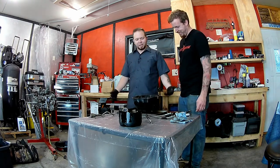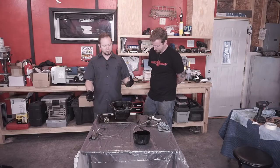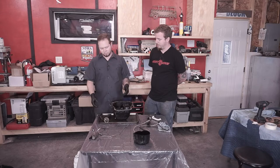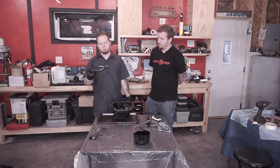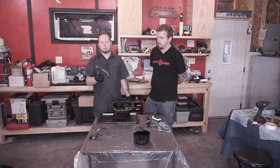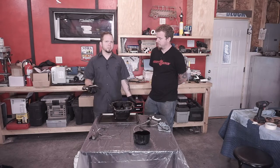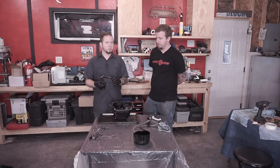So we have to try and clean this thing out. Your options are, you can either replace the whole thing. You can get a whole new oil pan, along with, no matter what, just replacing these. Even if you replace it with another OEM one, which, yes, they are actually prone to cracking. It doesn't happen that often. Usually it's a high mileage situation, or if your motor's harmonics are really off, you've got a really bad harmonic balancer, or you have funky vibrations.